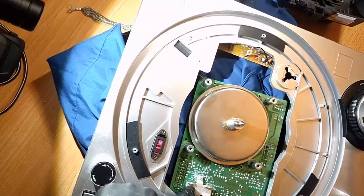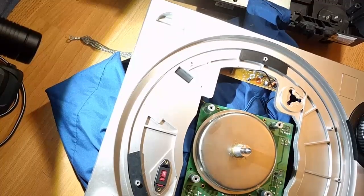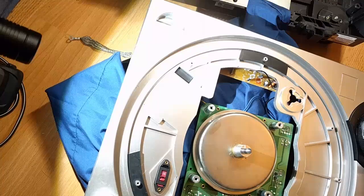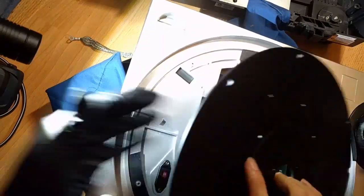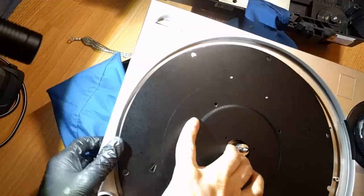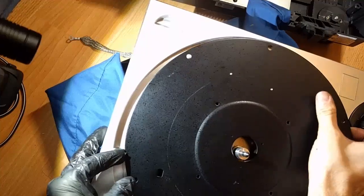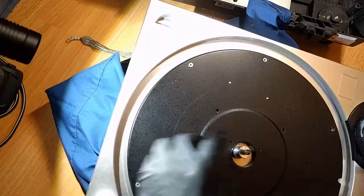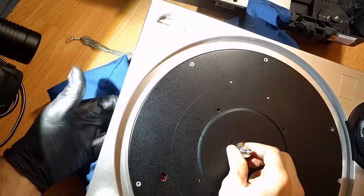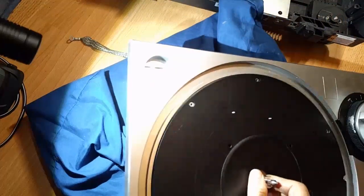If we look over here, we have our big heat sink mounted control, and then we have our region select switch for 115 or 220 volts. It's nice that the motor driver, I think it's the motor driver, has a big chunky heat sink. So I'm going to put our big metal plate on here now. Big heavy thing. And I guess there is an opening for the select switch, so that makes sense. Also helps you with alignment. And there's four standoff posts connected to the PCB. Again, not my favorite design.